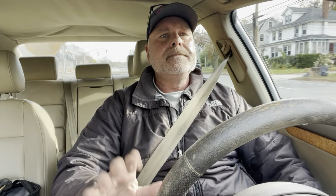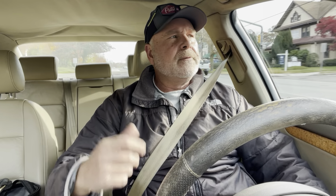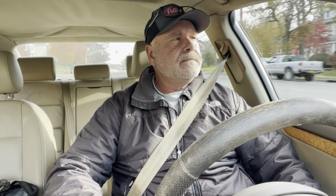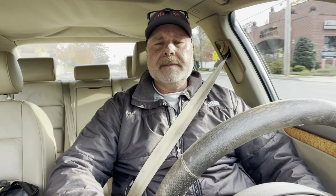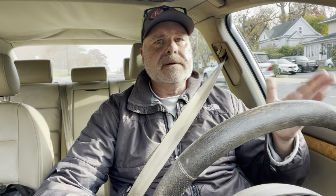So anyway, I pulled my brakes, took my Jakes off, got the temperature up to 185 degrees, tried to perform a regen, and it wouldn't let me. I contacted road assist. That's one good thing about Prime's road assist. They asked me if I did that, and I said yes. It's not responding. All right, take it to Peterbilt. We've got one there 30 miles away. Here's the confirmation code.